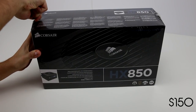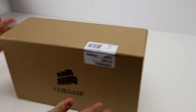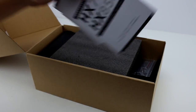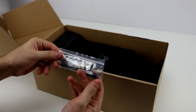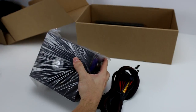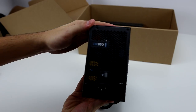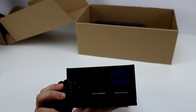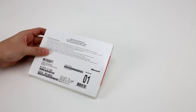I went with the HX850 power supply, which was way more than I needed. I got it to prepare for possible future upgrades and because it has a silent cooling fan. The 850 is 80 Plus Gold certified, meaning it provides high power efficiency of at least 87% at any load between 20 and 100%, saving money on your electrical bill, reducing heat, and prolonging the PC's life. The HX series generates less heat so the thermally controlled fan only spins when it's needed.